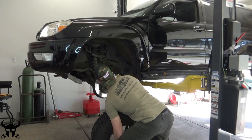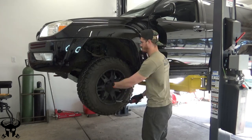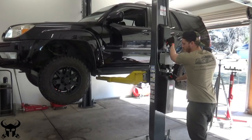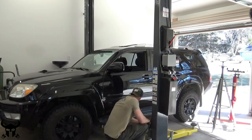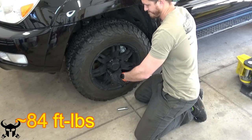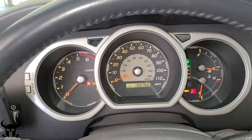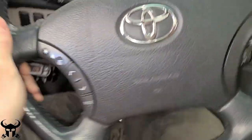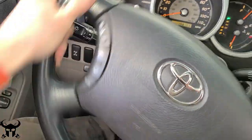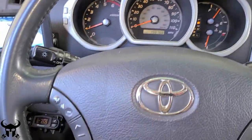Back to business — putting the wheels back on. For the wheel lugs, I use 84 foot-pounds. That feels perfect — it feels brand new again. One simple part. As you can see, we're not driving into the wall and the steering wheel is still straight.